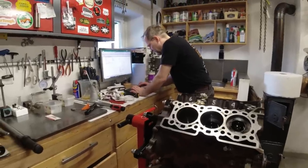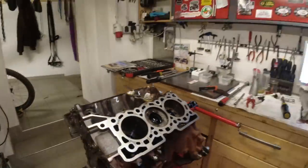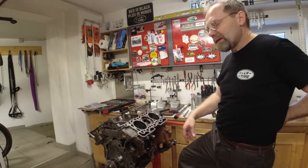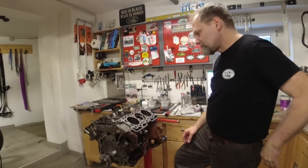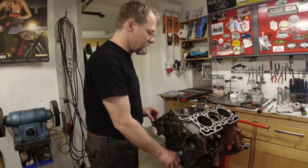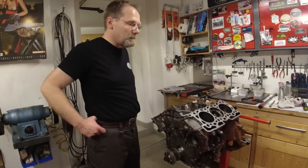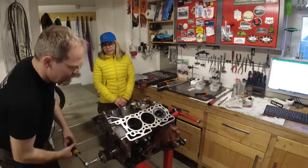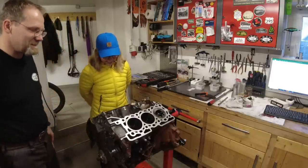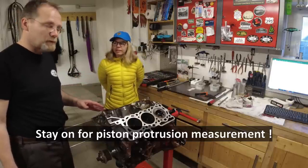Torque to rotate with pistons — all pretty. That's finished. This video is done. We're gonna have to measure the piston protrusion and we can't put that into the beginning of the other video. So stop — I'm gonna set up the piston protrusion real quick. I just want to check roughly what the piston protrusion is in case we have a problem. We are in the final step after the piston install, which is measuring the piston protrusion. The lower end is completely assembled. The next step would be to measure piston protrusion, order the head gaskets, put the heads on, and assemble the engine.